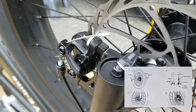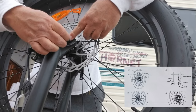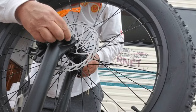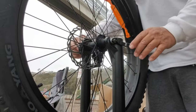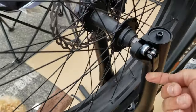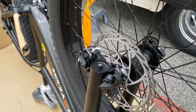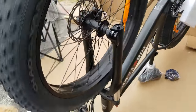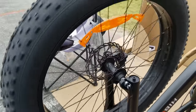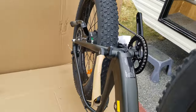I've got the spring in there and the nut, which came with the package. Put it on like this, pull down the other side with your hand while you tighten this one. Righty tighty — this will tighten up this edge nice and tight, just like the ones used to tighten the seat post down. Then spin the wheel — you're gonna hear a little bit of roughness, but that's fine. See how the wheel keeps spinning? That means the disc brake pads are not holding up the wheel.